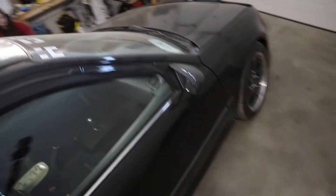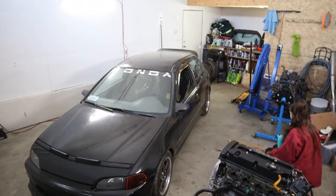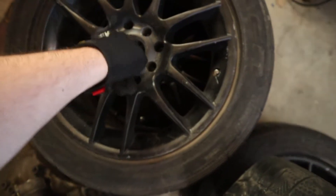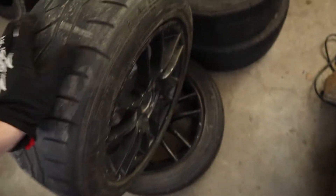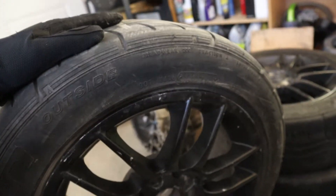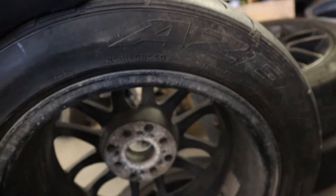I really need a wide-angle lens — I can hardly capture the full shop with this tiny lens. These are the wheels going on: one-two-three-four-five-six double-spoke multi-spoke wheels. I don't have center caps; I'm gonna have to get them. There are eight holes for different wheels. These tires are the exact tire size we're getting — these are Falken Azenis RT615Ks — 205/50/15. So this is a good look at the wheel width and sidewall we're gonna get. These wheels are 15x7, not 15x8, so we're getting this tire size but with an inch wider wheel eventually. Let's just go ahead and get these on the Civic and see what we're working with.